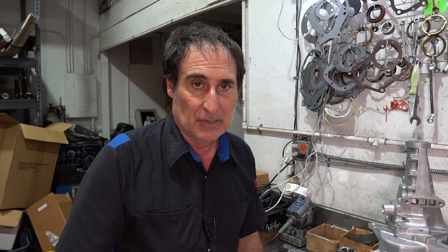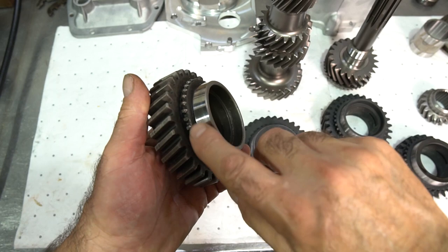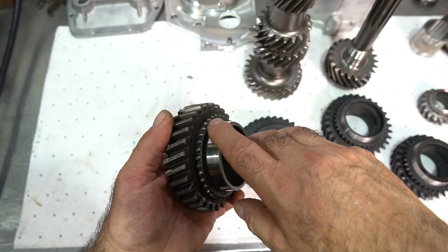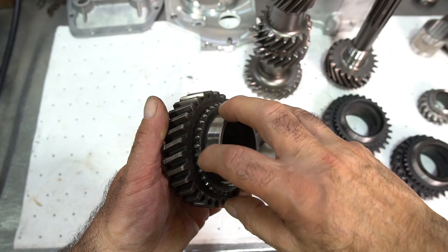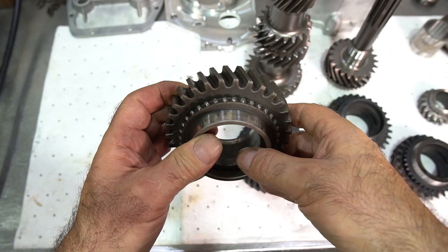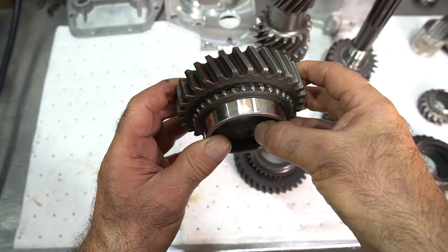Before I detail the whole gear set, I want to give you some pointers on things to look out for when inspecting gears before assembly. Some things are obvious and some are not. The engagement teeth on this gear are fairly worn — you can see how they're all chopped up and have lost their point definition. When they lose point definition, it causes the slider to wear as well. These teeth are flattened out, some are chipped up pretty bad. This is also what holds the transmission in gear, so if these teeth are worn and pushed back, the transmission won't stay in gear.